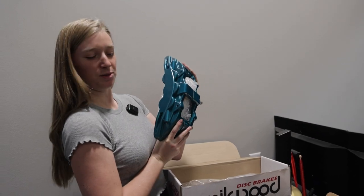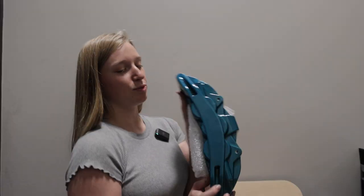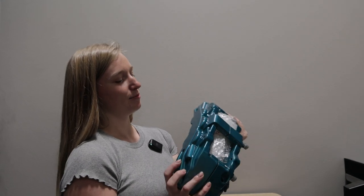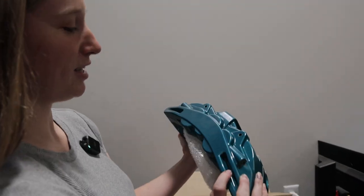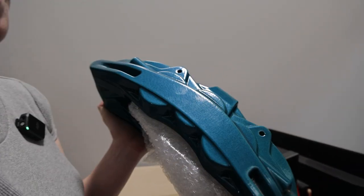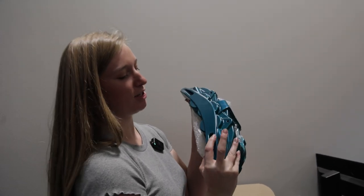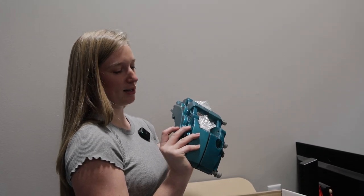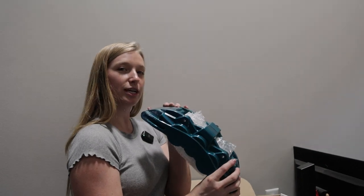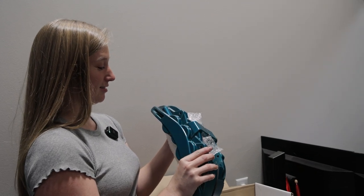We're definitely gonna have to reach out to Wilwood and get some white laser cut vinyl that says Wilwood, just because it's really hard to powder coat little letters like that and mask it all off, so it'll look really clean. And this color has a really nice little flake to it. I didn't want a completely flat color because my paint sparkles a little bit, so I have to throw sparkles everywhere. This is a translucent powder coating color, so you actually have to do a silver base. Otherwise, this thing would not be this pretty. That's what gives it so much depth, it's like a two-stage powder coat. I made everyone's life a little bit harder choosing this color, but well worth it. Came out really nice.